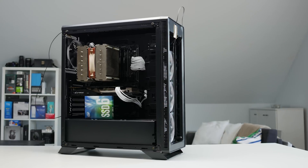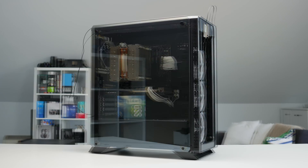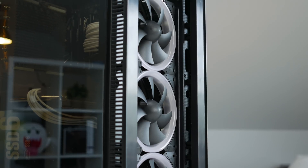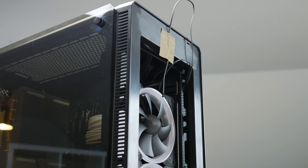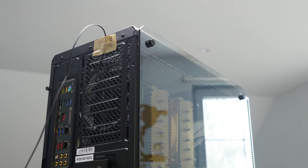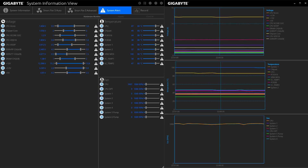Alright, so performance numbers at last. I'm doing all the testing on a Ryzen 7 1700 running at 1.4 volts, 3.9 GHz overclock. Case fans are set to the lowest setting so there's still airflow going on to help out the lesser fans and to not make it too easy on the system. I'm using a Noctua NHD14 cooler with a single fan in the center, which really stresses the importance of being able to build air pressure. For testing I also measured intake and exhaust air temperature using external probes, so I can compare intake temperature to exhaust temperature to get an idea of airflow.